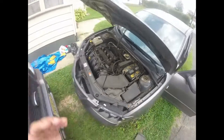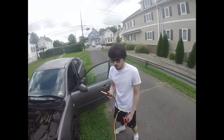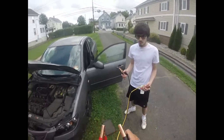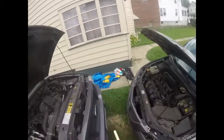When we set up our jumper cables, we go red to positive and black to negative. Me and Vinnie are going to pick up the jumper cables and hold them separate from each other, because if the clamps are touching when I put them on the battery, it's going to cause a short — there will be sparks, and possibly the wire can catch on fire.